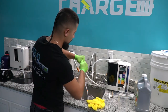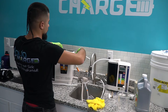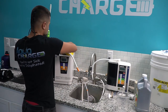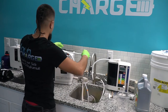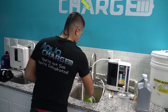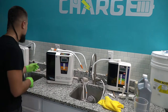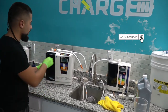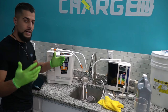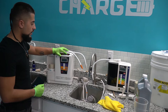After about five minutes on the last flush, stop the water, unhook the quick connect, unplug the hose, put it to the side, and put back the flex pipe. Now plug up your machine. Still with the CPU cartridge in — I don't have a new filter right now — so let's make sure the Kangen water is coming out good. To regulate the flow on the Super 501, you do it from the main. I suggest regulating the flow especially for testing to make sure the machine is operating at peak performance.